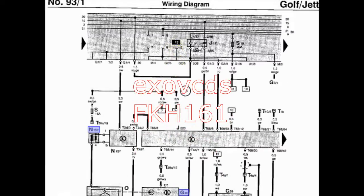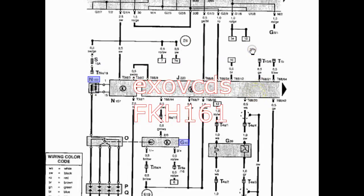This makes total sense: the fuel pump relay, once energized, feeds the fuel injectors. 30 is battery power all the time, 15 is the ignition circuit (key on), X is the load reduction relay side, and 31 is ground. So battery power comes down through the fuse box through the red/yellow wire, hits the fuel pump relay, and once the relay is grounded by the control unit, it closes and supplies power along circuit A down to fuse 18, which then supplies power to a couple of components.